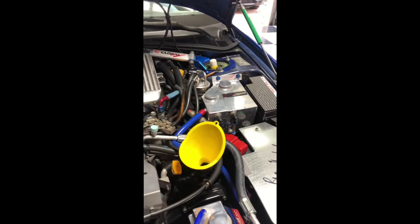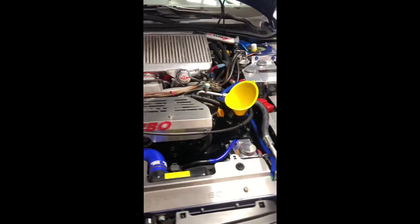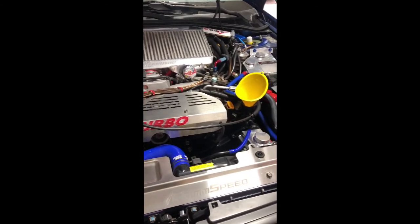Now we're going to head up and add the engine oil. We're going to put in 4.8 quarts — just pour it in and that's it. Start your engine and there you go — you've had your oil change done. You saved yourself some money. Hope you enjoyed this video. Have a good day.